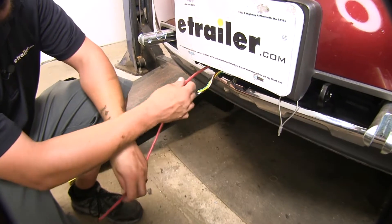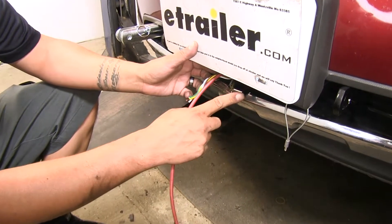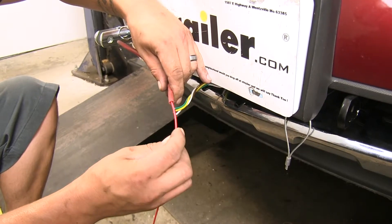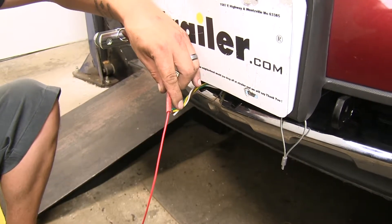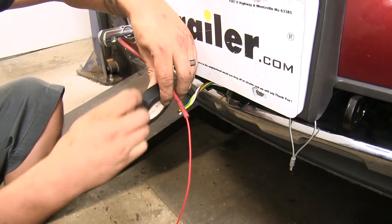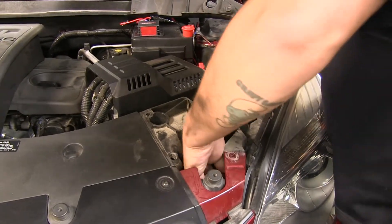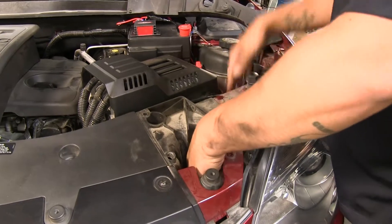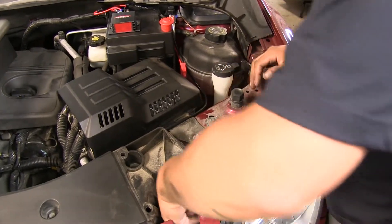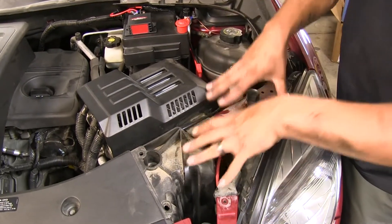I did have to go underneath my vehicle and find my wire and then I passed it through to where my four-pole wiring is coming out and my two prongs are where I'm going to mount my plug. I'm going to take my red wire from my charge line kit and put it inside my airline tube. I'm going to take some electrical tape and secure it — that way when I start pulling, I don't lose the wire. I'm going to go underneath this support right here and come back and bring it up through here for a more direct path, which beats going over the top and having that panel on top of it.